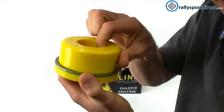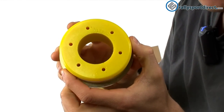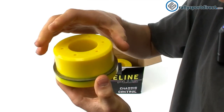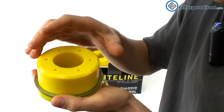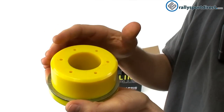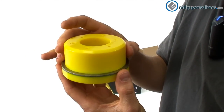They are made out of a hard and durable polyurethane. Imagine your stock bushings, which are made out of — I don't know — gum or something like that, and you're going around a corner and it's deflecting. When you get out of that corner, it has all this energy stored up into it and it springs back. So you kind of get the rear end kicking out on you a little bit, which makes the car feel a little bit unpredictable.